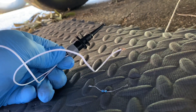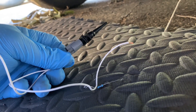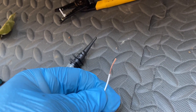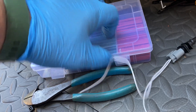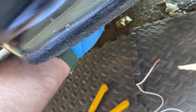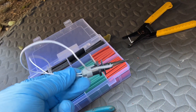Hopefully that will clear the check engine light we're getting for the ambient air temperature sensor, and also a secondary code that says the intake temperature is improbable — we'll see what that's all about. We've stripped off some more of the wiring to give us a good amount to twist. There's not a whole lot of wire left, so we're gonna put some heat shrink on, reach up inside, twist them together, slide the heat shrink over, hit it with the heat gun, and then zip tie it up underneath.